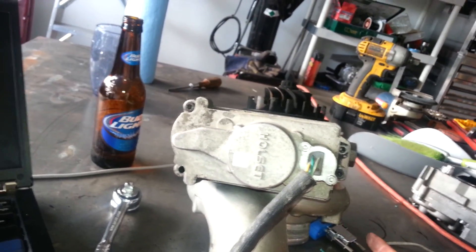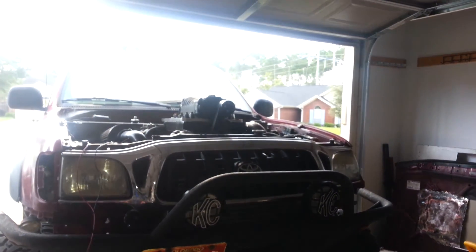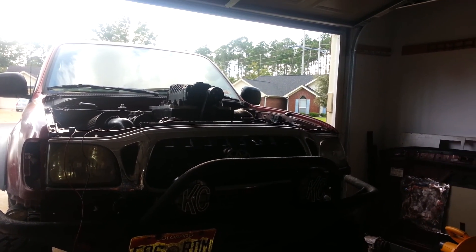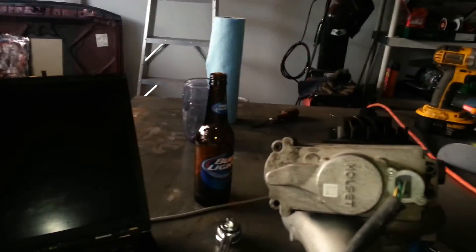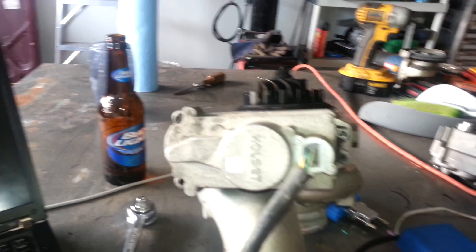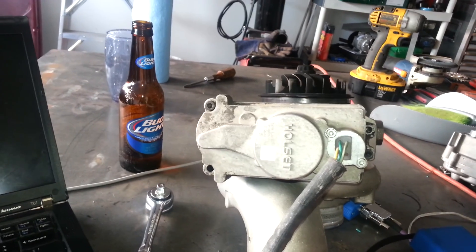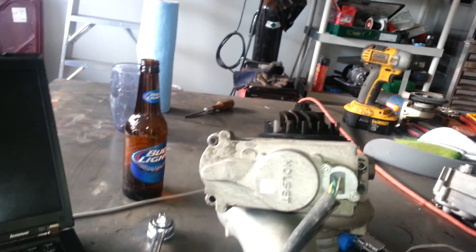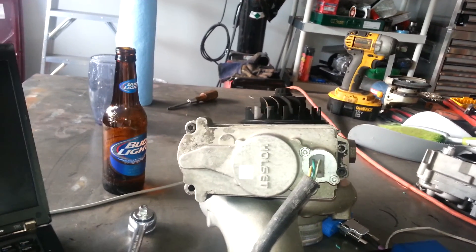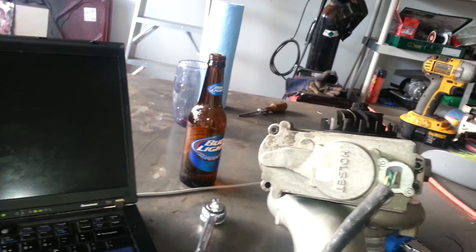It might seem like a big turbo for a small 4BT, but on my engine I have a supercharger off an M122 — an M122 supercharger off a GT500. I actually make about 3 to 5 pounds of boost, depending on whether the engine's hot or not. From there I can actually have this turbo fully open, and if I'm going 45 miles an hour down the road, I can completely light the turbo. So having that 7 centimeters, it just lights it almost instantaneously all the way up.